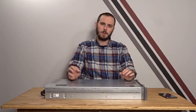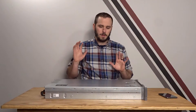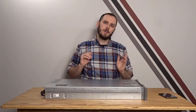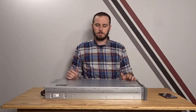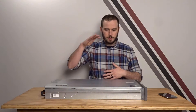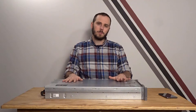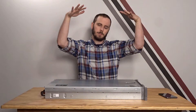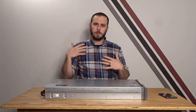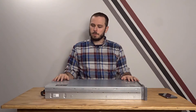Let's talk about how you want to set up items in your rack efficiently so you don't make it too top-heavy. One of the biggest dangers — especially with a rolling rack — is putting too many heavy items at the top and light items at the bottom so it tips over. That's probably what happened to my rack when it was all bent up. Generally speaking, the way most racks are set up is networking gear at the top because it's the lightest, then servers below that, then heavier storage gear, and finally at the very bottom things like UPS units — uninterruptible power supplies — which are one of the heaviest things in a rack.